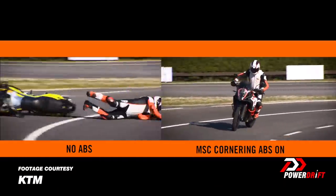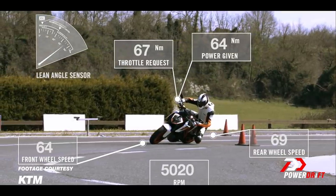You can add more electronics and intelligence to this. With cornering ABS, the computer gains data about the lean angle of the motorcycle and calculates how much pressure needs to be released and when intervention should happen. Pressure intervention is one reason why you'll love some ABS systems and hate others — a lot of work goes into calibrating how an ABS system comes alive. One factor is how fast the system can cycle: a 10 Hz system intervenes 10 times per second, which is pretty quick, but faster systems can hit 50 Hz or even 100 Hz. At 100 Hz, the system recognizes a problem 100 times a second, so you almost never feel the approach to lock-up, and the lever pulsing is so small it feels like slight vibration. At 5 or 10 Hz, you feel it as an actual pulse of the lever.